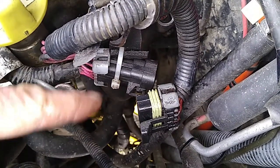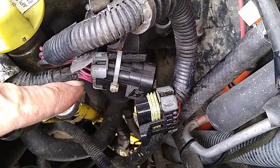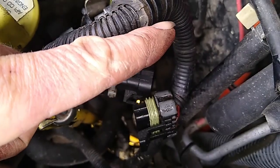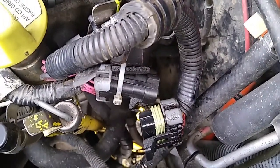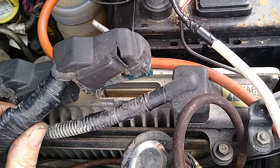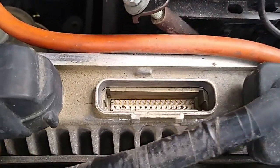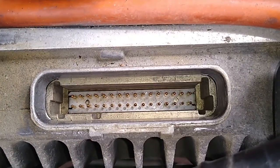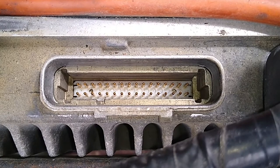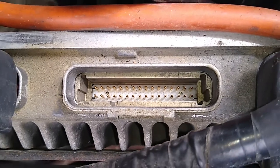The only danger here is with this oil, which capillaries down the wires from the sensors and the engine, makes its way through this connector and into the next one, and then continues its path all the way back to the computer - which is not so good. This is the computer here, and what I've done is I've pulled the connectors out of the top. What you want to do is carefully lift these connectors out and peer down into the top of these pins and look for oil leaking. That oil comes from your injector harness, and you don't want oil getting in here because it will probably wreck your computer.